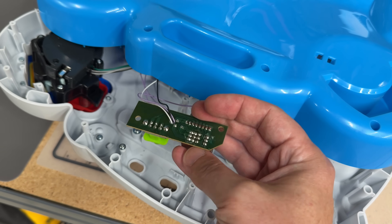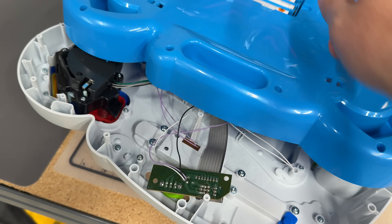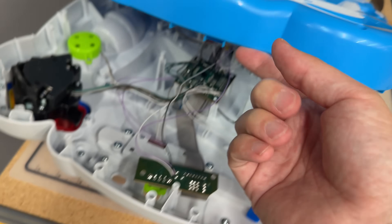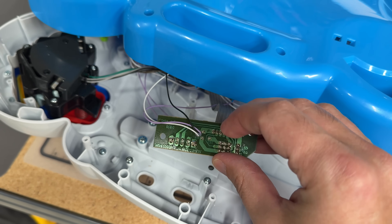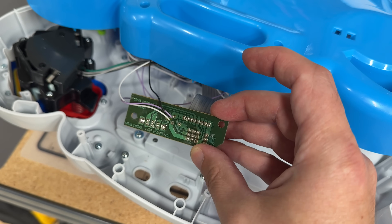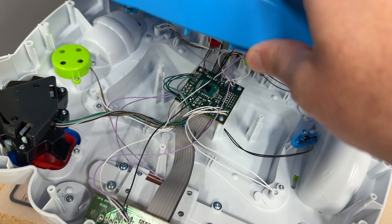Another funny thing is if it's in Spanish mode, it seems more reliable. In English, it doesn't. I'm guessing that's with this little switch matrix on the back here that takes the power in from these batteries — that's what these wires are. It comes into the board on these traces, goes over to the main switch, and then switches on and feeds the MCU both inputs. That ribbon cable goes over to the little main controller board, and it is the brains behind everything.